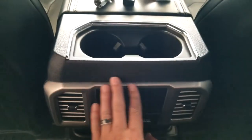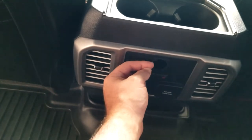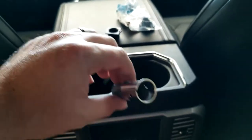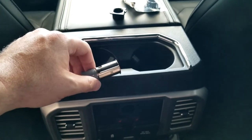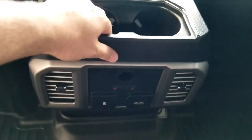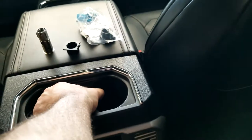What I started trying to do is pull this trim piece off, and I was having issues. I thought maybe I could get a screwdriver behind here and pop out the 12-volt hookup and see if I could pull it out. But what I ultimately ended up finding, which helped the most, was if you pull on your cup holder here.